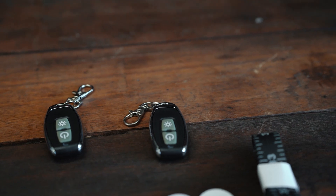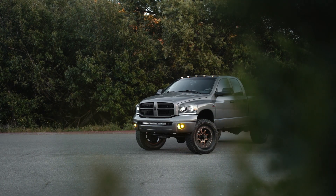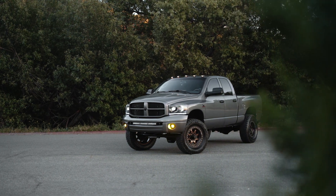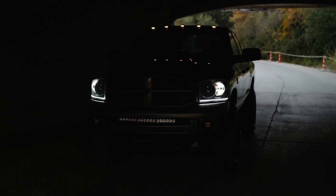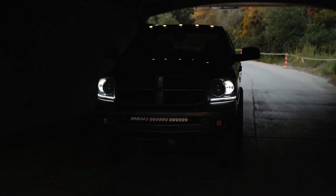Now, if your cab lights do go out of sync, what you have to do is pull the ones that are out of sync off the truck, take them far enough away that the remote doesn't turn on the other lights, turn them on, get them all in the same mode, and put them back on the truck. It's a pretty easy process because there are literally only two bolts separating you from pulling the light out of the housing, but it is a little bit of a pain.